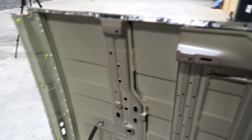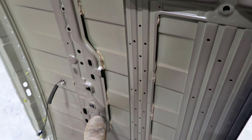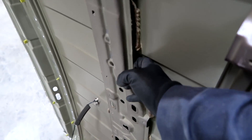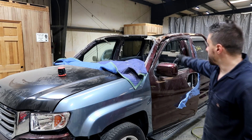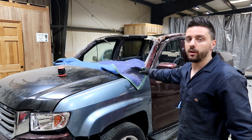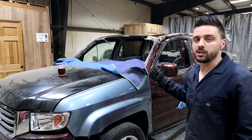Let me show you guys the other side real quick. Basically all these braces stay with it, which is awesome because I won't have to apply any of this seam sealer — it's holding it together. Before I start on removing the pillar, I have to remove the fender and the door because it is damaged up here. The new door is sitting against the wall. Let's remove the door, then we're going to remove the pillar, and once we install the new pillar we'll test fit the new door as well.